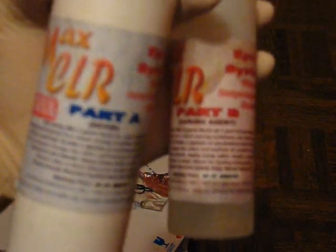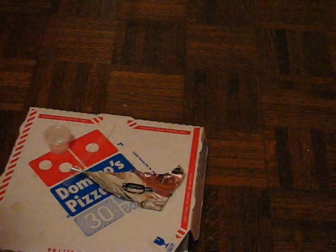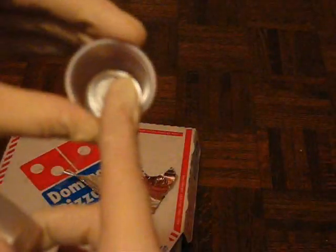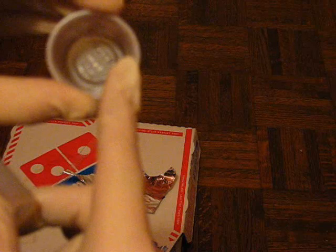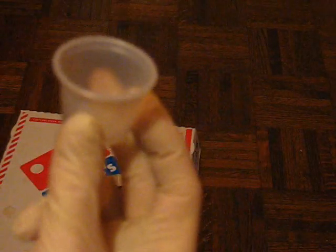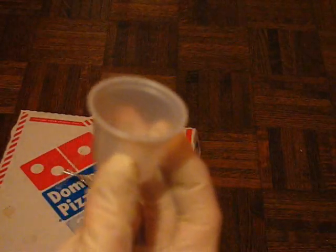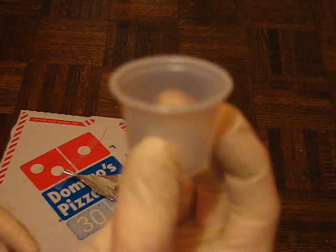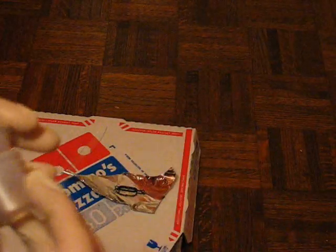If you're a fabricator or you want to make some carbon fiber body parts, I would suggest you get this. It's also handy for repairing plastic because it's nice and sticky and hard. You're going to need a minimum of two cups — one's for mixing. Then you pour the mixed mixture into another cup so you make sure this cup doesn't have any excess hardener or polyurethane that hasn't mixed properly, because that will ruin things. It's got to be a homogenous mixture.